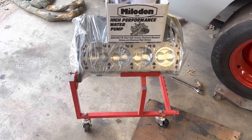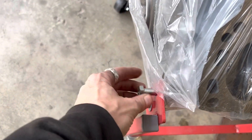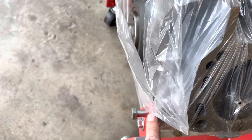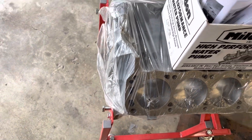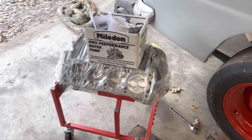I did put some bigger bolts in the place where it comes with a bolt in back, but then there's just a hole where the locating pins — the pins that stick out of the engine — would normally go. I just used a bigger bolt to slide in there just in case.